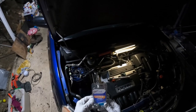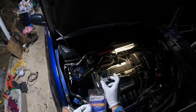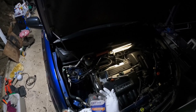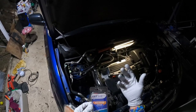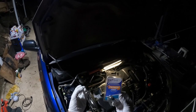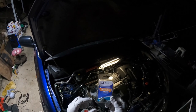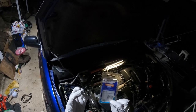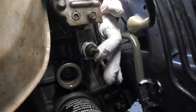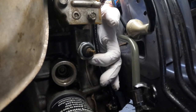The reason we're replacing ours is because there's oil leaking off behind it. It's normally mistaken that the VTEC solenoid gasket is leaking. We replaced that gasket and found something was still leaking. We figured out that just underneath where the VTEC solenoid gasket is, there's the oil pressure sensor — it has a little plug that sits on it and that was covered in oil as well.